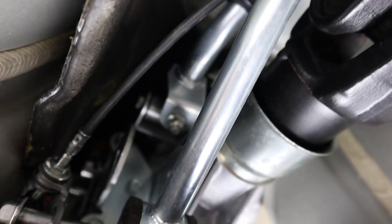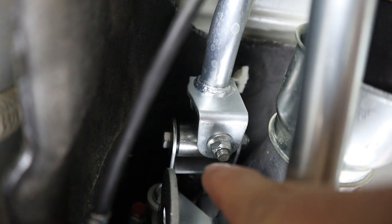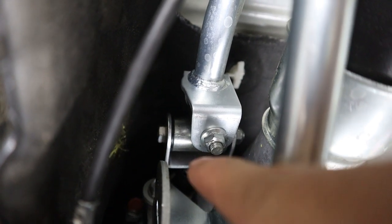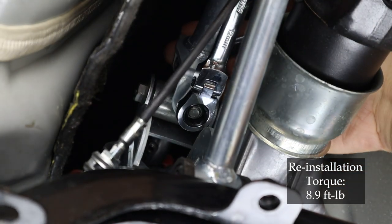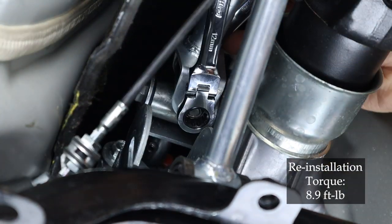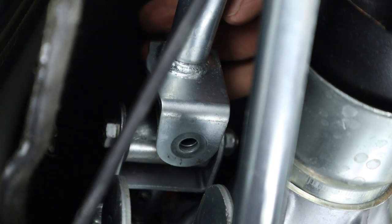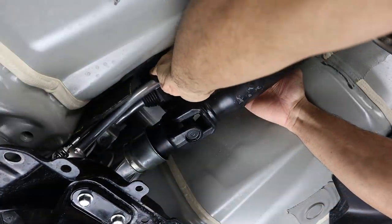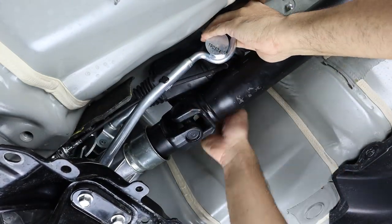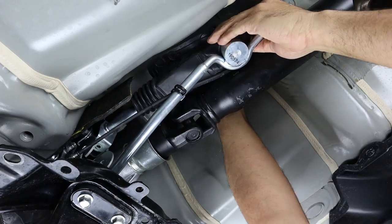We've reached the point where things could potentially get difficult. You have to remove one of these two bolts right here and there's not enough room to remove either of them. The horizontal bolt requires that the transmission be pushed to the right in order to get enough clearance, and I found it impossible to do by myself — I couldn't move the transmission enough to get the room needed to remove that bolt. So I left that bolt alone and instead removed the nut from the vertical bolt. The nut is 12 millimeters and the bolt on top is 14 — you have to get a wrench and hold it still otherwise the nut will just spin freely. Once you get the nut out you'll be able to push it through, but there's still not going to be enough room to completely remove it just yet. If you do it right, you can maneuver the whole shifter assembly to angle that bolt just enough to get enough room behind it, work it out of the opening to the side of the propeller shaft, lower it, and then you'll be able to remove the bolt. With the bolt out you can continue to maneuver the entire assembly and get it out.